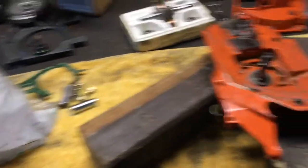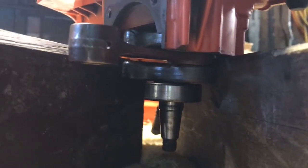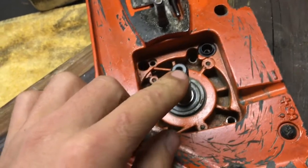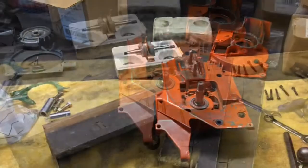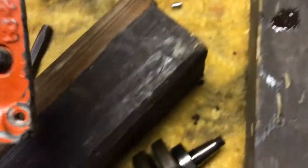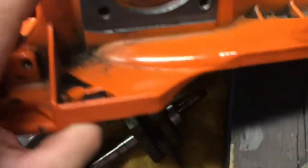I used three of my little spreaders. The bearing is on the crank, which that's fine. I'm going to remove the crankshaft by using a center punch and beating it out. No problems there. Going to have to remove that old bearing. That's not a problem, we'll get that out too. Must be in there pretty good.